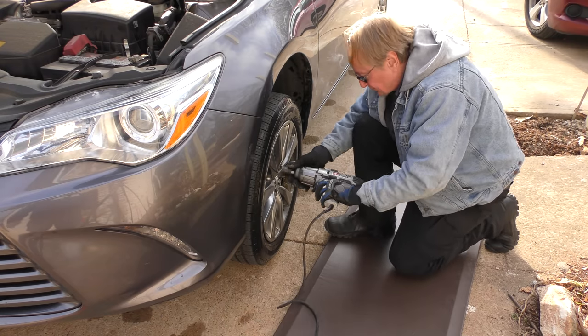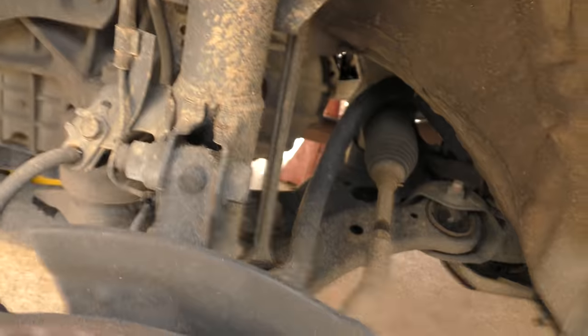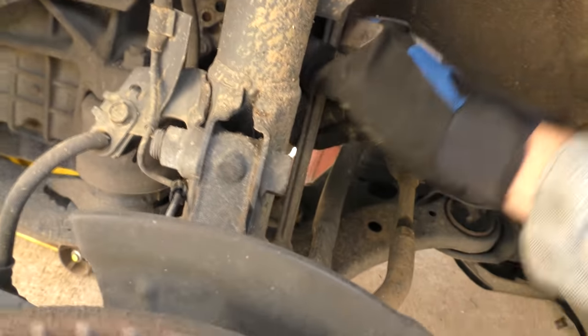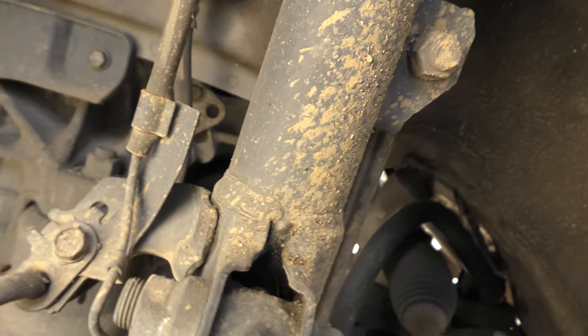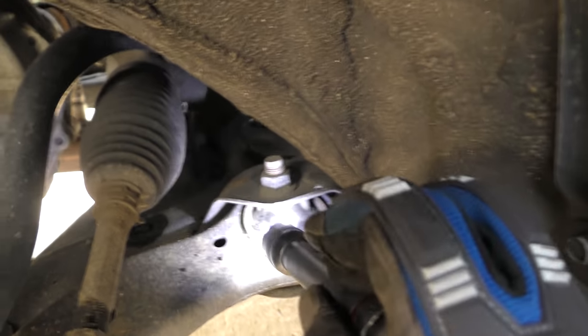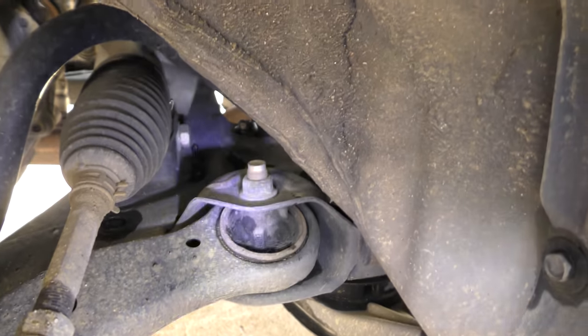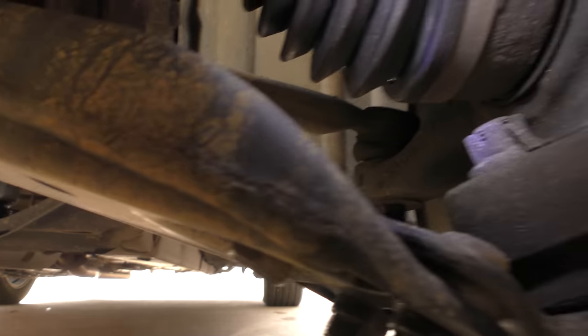Let's pull off this wheel — off it comes. Do the same process here. Even though it's plastic, it's still solid, the stabilizer bolt. And we'll look down here — this is pretty much the same as the other one. You can see small striations, but there's really nothing wrong with it. And as we look under here, the ball joint's solid again, it's not leaking grease, everything's pretty solid. The only thing wet is because you got the car washed. So there's no obvious structural problems.